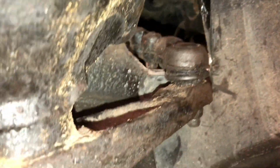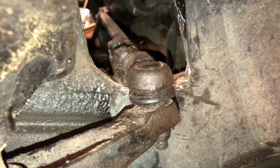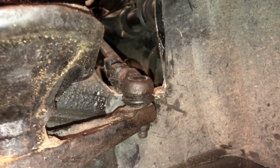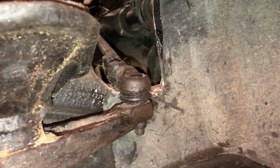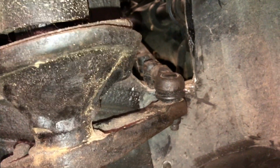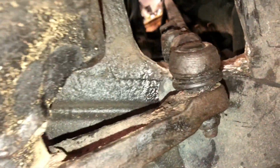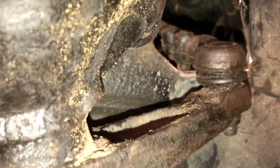But you can imagine if I had another 1 centimetre off, that would be quite a problem and require some cutting and re-welding into that box section. And as it is, I've rotated the end of the steering arm slightly. So yeah, 40mm, it's probably best to stick to that if you don't want to do too much cutting and welding. And even with the 40mm, there's a fair bit cut off there.